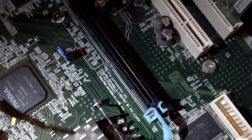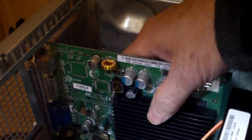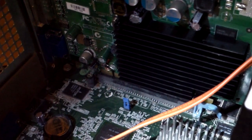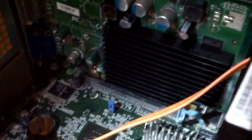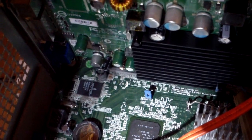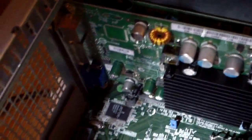I'm just going to put the new card in. This is the old card — looks exactly the same — and this is the new one. You just try to fit it into this slot here. Make sure that it is aligned correctly, and then you press it in evenly. The trick is to pull that blue plastic lever while you're inserting your new card so that it doesn't get in the way and you can seat the card in completely.